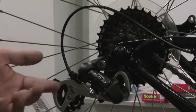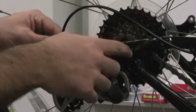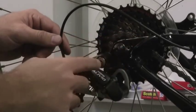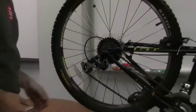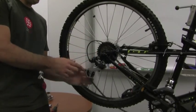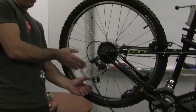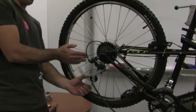If that's the case, you'll want to check your derailleur hanger. The derailleur hanger is this small piece of aluminum right here that connects your derailleur to the frame with this large 5mm Allen bolt. The first thing you'll want to do is just visually inspect it from the back, and if you can see that this cage right here that holds the jockey wheels is not perpendicular with the ground, you'll know that you'll need to do some work to realign your derailleur hanger.